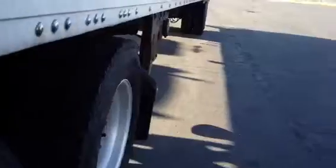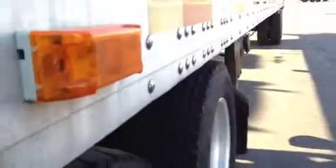Check your air lines. They're properly mounted and secured. Move right into your glad hands. They're mounted to the trailer good. Okay, your deck is free of debris. Properly mounted and secured. Supports the weight of the driver. Move down here. Check your drive line and your U-joint bolts. Fuel tank properly mounted and secured. It's not leaking. Steps support the weight of the driver. Fuel cap is on. Okay, and we'll inspect the brakes and the chambers and the suspension the same way we did back up there, with a couple of variations because we have airbags back here. We'll get more into that later.